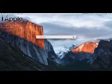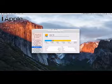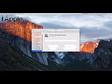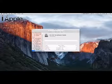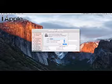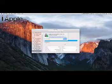If you want to initialize the RAID on a computer with Mac operating system, please search for Disk Utility on desktop. Look for a new disk in the External menu. This disk is the TerraMaster RAID that has not been initialized. Please select the disk and click on Erase. Please complete the setting and click on Erase. The initialization of RAID is fully complete after erasing.